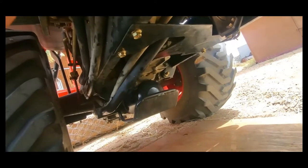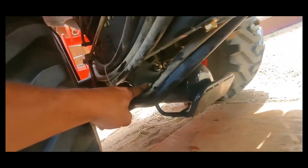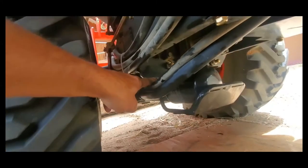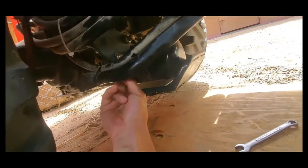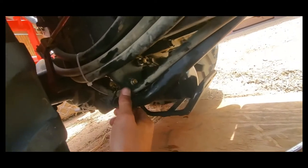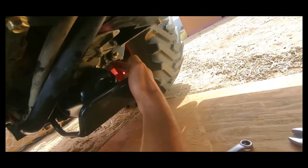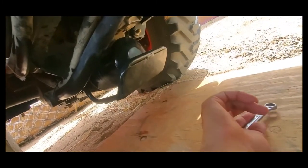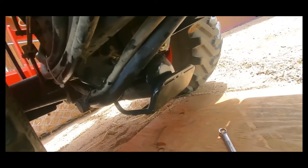The guards are back in place, but note that the one right here is in a very difficult location — it's hard to get a wrench in there and you'll have to fight with it. Also make sure you get the through-bolt on the other side back in, because it goes through the casing, not just into it. If it's not in or tight enough you could end up with a leak. They are all 12 millimeter.